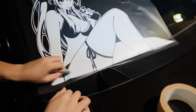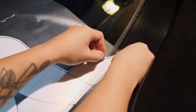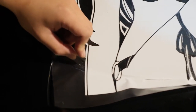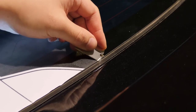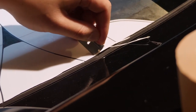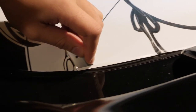If you get to the edge and want to make a cut, use the tool to make a firm crease along the edges of the glass and the vinyl. Take your razor and make the first cut along the edge of the glass and the vinyl. Slowly remove the excess material. Now go back and clean up the edge with a second run — using firm pressure, push the razor against the edge of the glass and run it down the material. Hold the blade at a certain angle and keep it consistent while moving down the entire edge. This process is much easier if you have a brand new sharp razor blade.